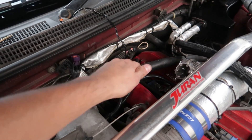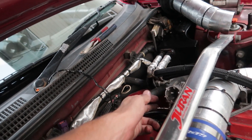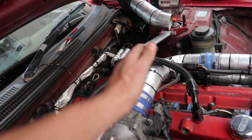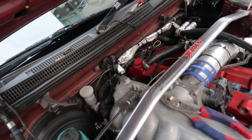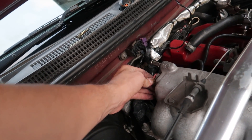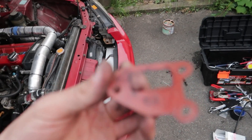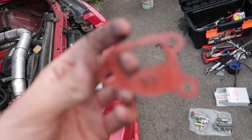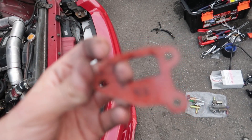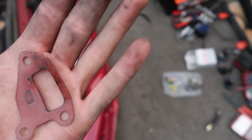I've already replaced the whole vacuum line with just a single line, since there's no need for the T-piece if I'm not hooking it up to the blow-off valve — that's blocked off with a block-off plate anyway. I've also taken off the ISCV valve. I can peel this gasket off now — it's an old one that came off in one piece without breaking, which is super rare. But you can see the gasket started failing; it's been breaching past the gasket around the edges, almost like a head gasket failure. So it was about due to fail anyways.